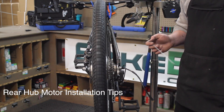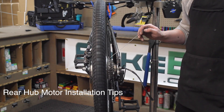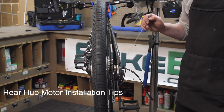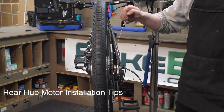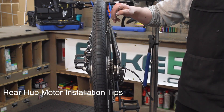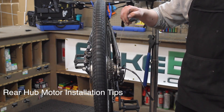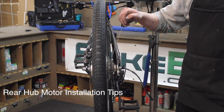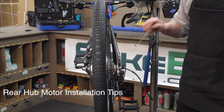More modern bikes have the cassette type, so this freewheel would be an aftermarket piece purchased for this particular application. For installation, I took time to make sure the spacers were in the correct position, the locking washer, the locking nuts, and the appropriate spacing were all set before installing the freewheel for the last time and then installing the wheel.